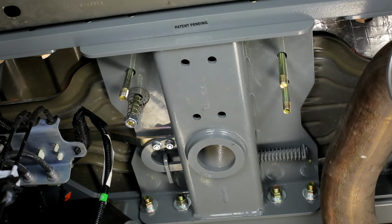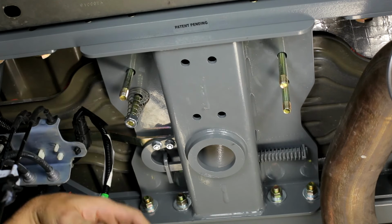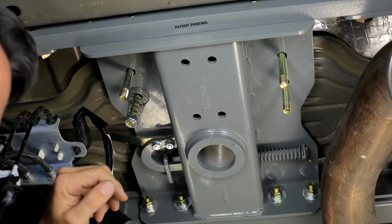All right, we've got our 1/2 inch holes drilled through the bed for the safety chain loops. I've already taken the time to eliminate the filings and coat that raw aluminum from inside the truck bed. Then I drop the U-bolts down through the holes, as you can see here. Now I've got this front one done so that you can see what it should look like when you're finished.